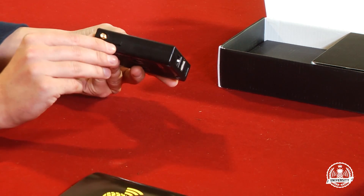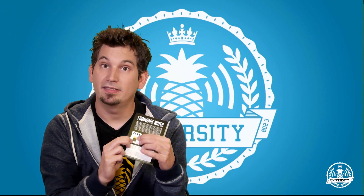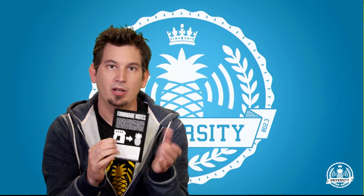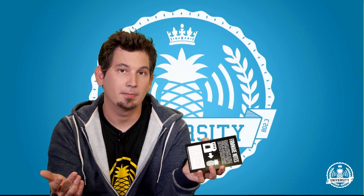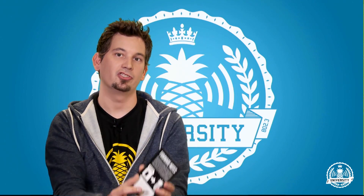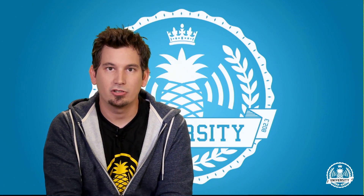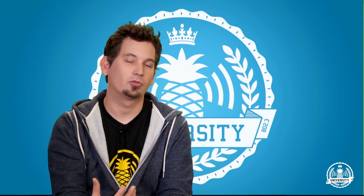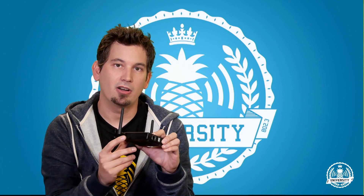The microSD slot allows you to upgrade the memory on the pineapple. We include a 2GB microSD card with firmware files pre-installed — we'll get into flashing the firmware in the next video. You can upgrade your SD card all the way up to 32GB after the first boot flashing procedure. We support EXT as well as FAT — FAT is convenient for Windows users as no additional software is needed. You can also format right from the web UI, which partitions the drive so you have swap space for running more concurrent applications. Importantly, you must have a microSD card installed to boot.